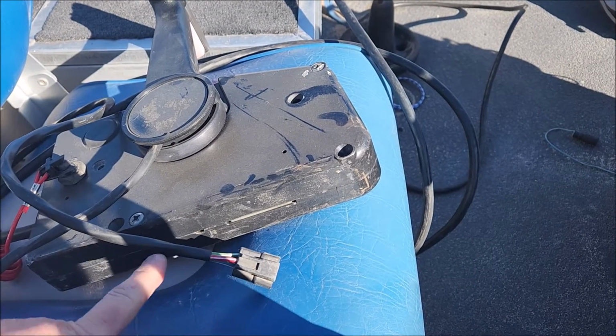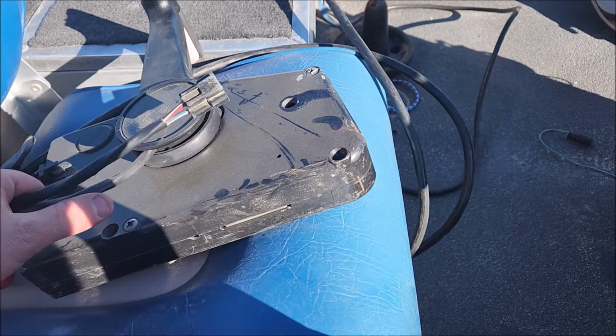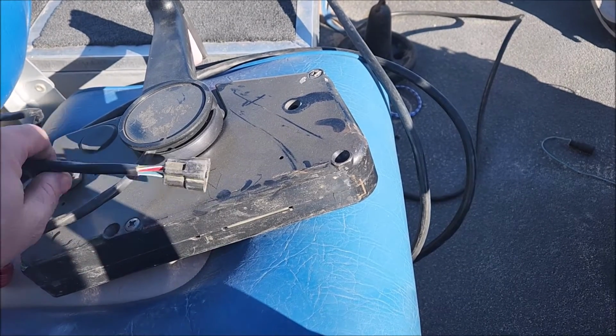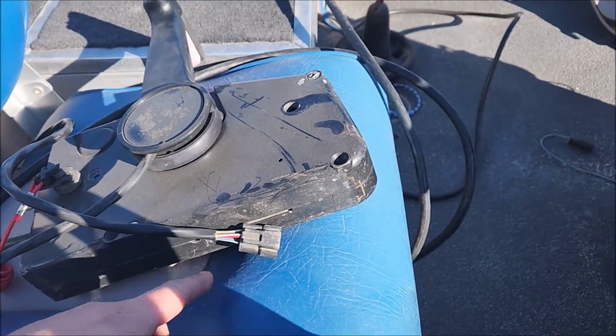So what you're going to do is, not on the plug side, but on the other end, because you don't want to hurt the controller wiring or switch wiring, although it doesn't matter, you're going to want to cut and splice into those wires and then run 3 more up: red, blue, and green.